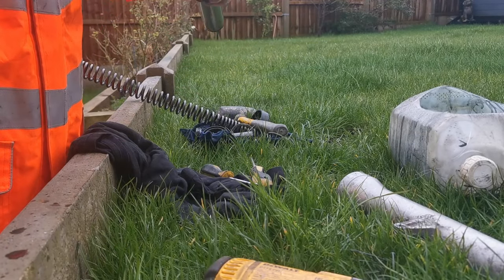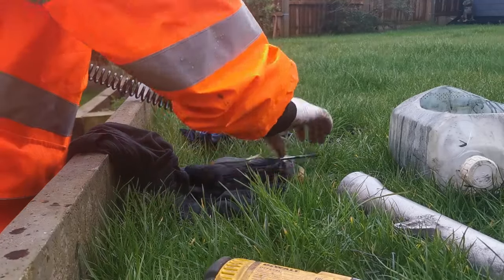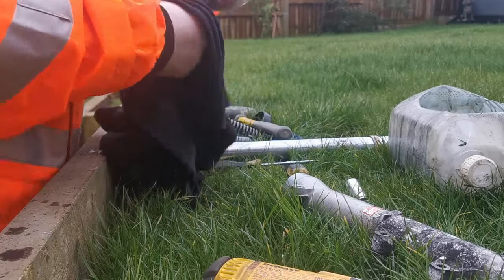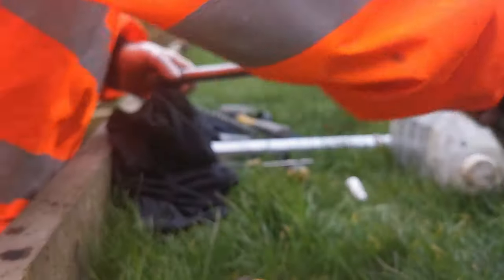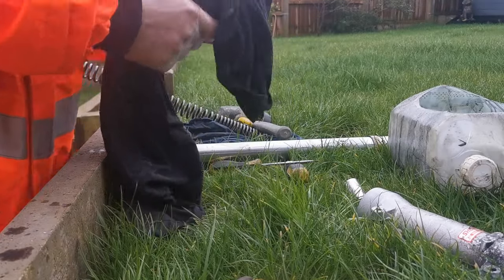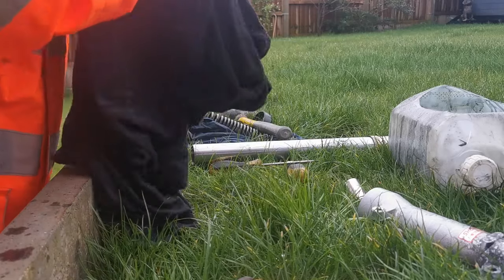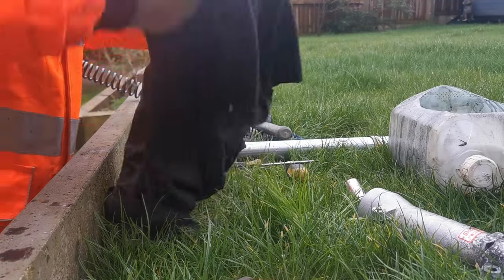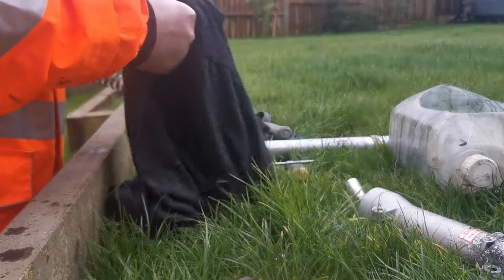and now I'm just looking at the copper inserts for damage, and they both look fine. So what we'll do now is just give that a clean, get as much of the old oil off as possible. Ready to go back. So already we're preparing for the rebuild, and we are on 13 minutes, which is not bad. If you're not sure how this comes apart, then take pictures or write notes if you're doing it. It is very important that it goes back in the correct order.